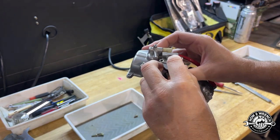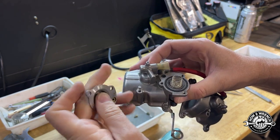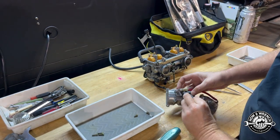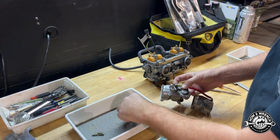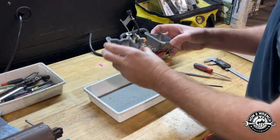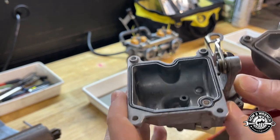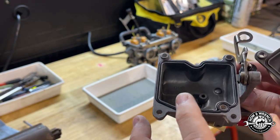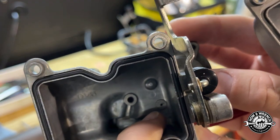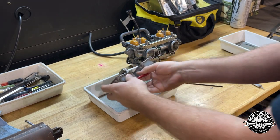I've got the spring that seats in there, and the other side has to seat here — what you don't want to do is get it cocked sideways. You really want to look at it as you put it on to make sure it seats properly. You may have two seals on your design sometimes — there are two passageways there, so look out for that. That little hole in there needs to fill the fuel waiting for this accelerator pump to work. How small that hole is — the tiniest little bit of blockage stops the entire circuit.